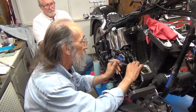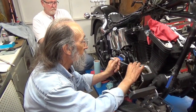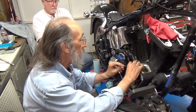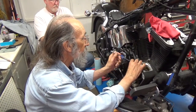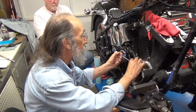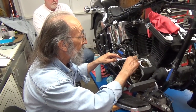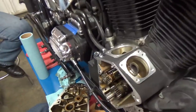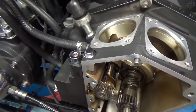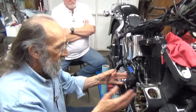So I'm putting it back in. This is not the original plug — the original plug is slotted like a normal screwdriver slot, and to really get it out without too much effort you need a drag link screwdriver, which you put on a ratchet or breaker bar and it fits that slot. I like to change to one of these aftermarket plugs that I can put a wrench on. There's a nice fresh o-ring in there, and it's sealed up good and tight. I only put it on now because I'm doing other things here and I prefer not to have an open hole there.